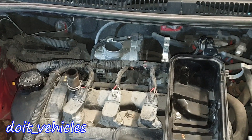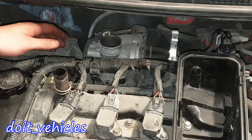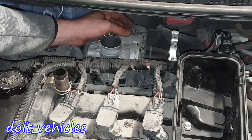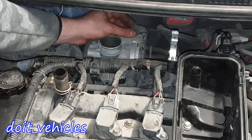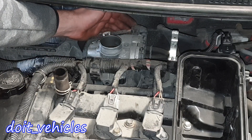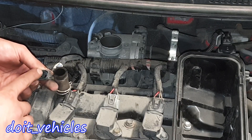There are two other cars with the same engine: a Citroen C1 and Toyota Aygo. On one of them you've got the wire throttle body which has only a position sensor on the throttle body, while this one is electrically actuated. Let's unplug this to see what the voltage values are.